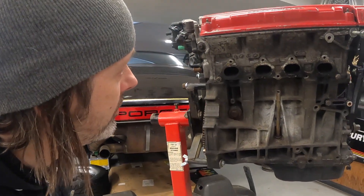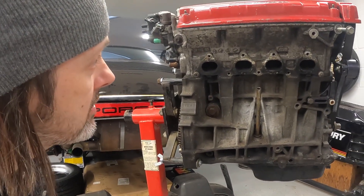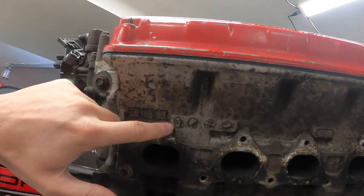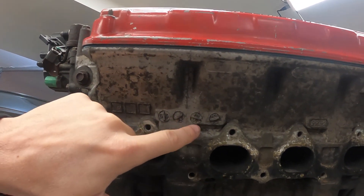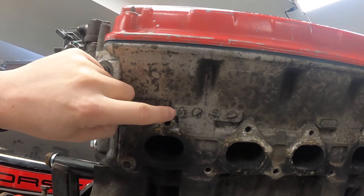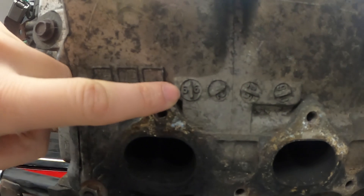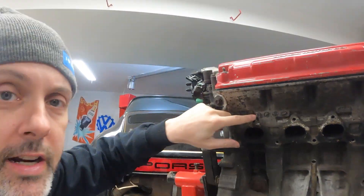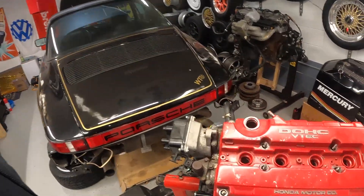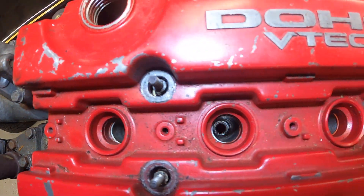What we should be able to do is look at the date code on the heads to figure that out. Right here you're going to see these little circular casting marks - these are rotated and changed out as these heads were produced. The first one reads six-six, but if you flip that around it's actually nine-nine. So this must be from a 99 Civic Si.